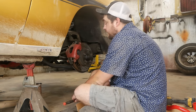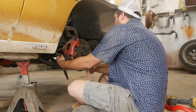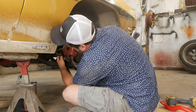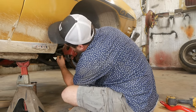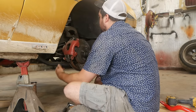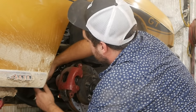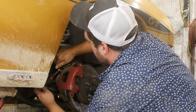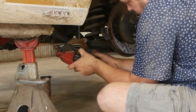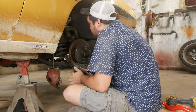I'm going to start on the front. First step is just remove the calipers and pop the rotors off. It hasn't been that long since I've been in here — I put brakes in it not that long ago, and I did buy all new steering components for it. One thing when taking calipers off: don't leave them hanging by the hoses. I'll use some bailing wire to hang them up off of something.